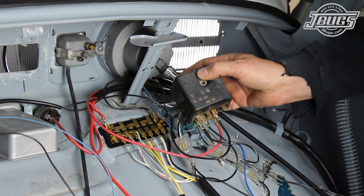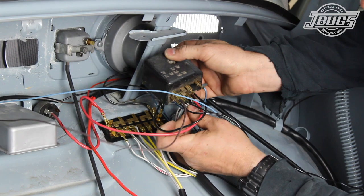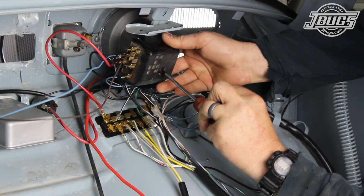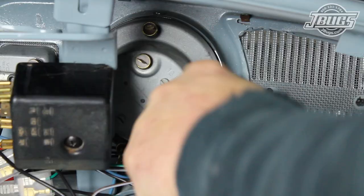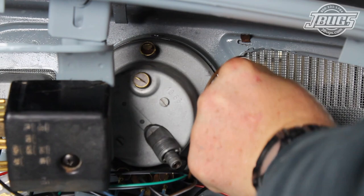At the relay, the brown wire is connected to the S terminal. We install a piggyback terminal at the 49A terminal on the relay and the blue wire connects to it. The black-white-green wire from the turn signal switch is connected to the piggyback terminal as well. The short loose blue-green wire is connected from the KBL terminal to the turn signal indicator bulb on the speedometer. The flasher relay grounds out through the mounting screw, which runs through the relay to the dash brace behind the speedometer. Next we'll install a ground terminal ring at the speedometer mounting screw to plug in the brown ground wire from the turn signal switch.